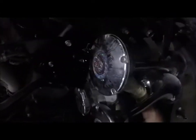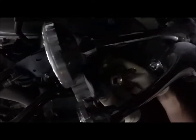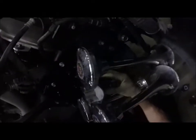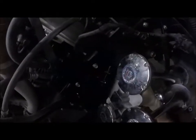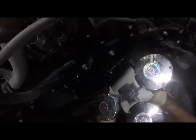These do come off, but they're not that great to get off, so I'm not gonna try to take them off. What I will do, however, since I didn't tighten it down, is I'll take the coil out. Just make it kind of easy to spin this thing in there. It's a magnetic valve. When that coil activates, it creates magnetic energy and causes this to open and close. So I'm just gonna spin it in there until it's snug by hand. Remember, there's no pressure on the other side of this. So that should be good right there.